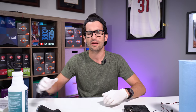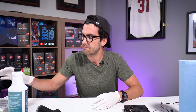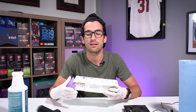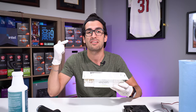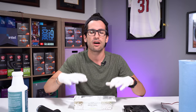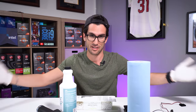A lot of people have been saying, 'Why don't you use brushes? Brushes work just as well. You get the anti-static ones so they don't cause any harm to any SMDs on boards you're cleaning, and you'll get the job done faster.' Well, I like the precision aspect of Q-tips. Yes, it does take longer to clean with Q-tips, but when it comes to fans in particular, which have a lot of hard-to-reach places, Q-tips come in very handy. These four things are what I recommend. Focus on these for the fan in particular.